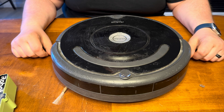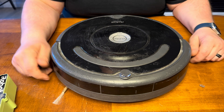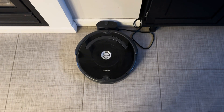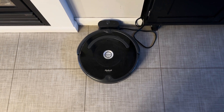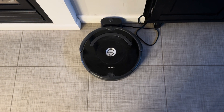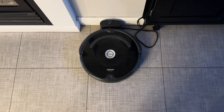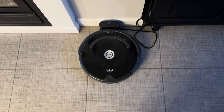So that's it — that's how you change the battery in your Roomba. It's going to need to be charged, looks like it's dead, so we'll get it on the charger and see how she runs. Quick follow-up: if you place your unit on the base and the clean light is flashing — the clean button in the center — that means it's downloading an update from iRobot. Just let it do its thing, sit on the base, get its firmware update, and then you should be good to run.